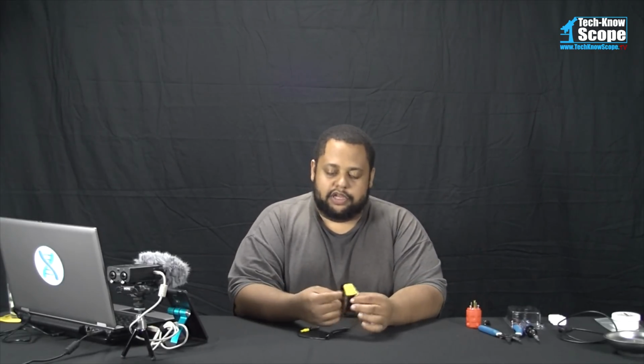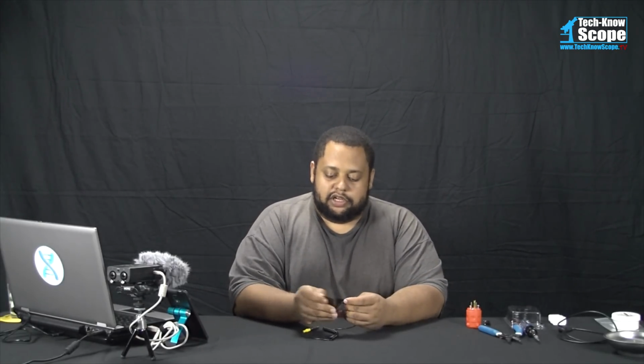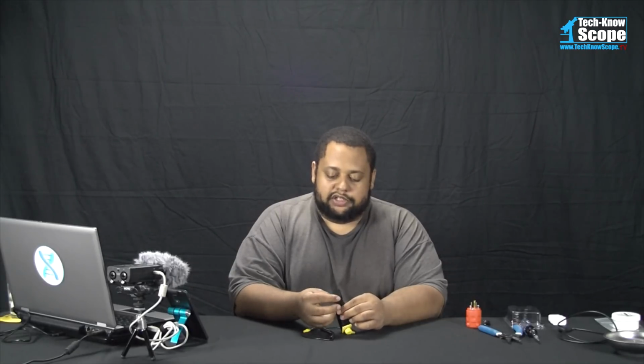Now, moving on from that, the other thing I want to talk about was ESD. Now, in my last video about building the computer for my son, we talked a little about ESD and some of the problems that it can cause. Now, the way that semiconductors work is they are transistors that have an insulating barrier in them. They will have voltage applied to one side. This barrier is set up that will not allow electricity to flow without voltage being applied. And then once voltage is applied, the electricity is conducted to the other side of the transistor.